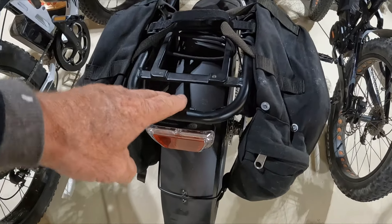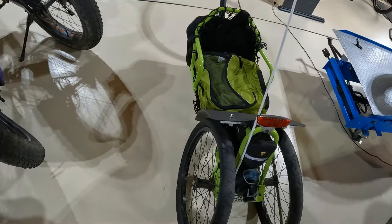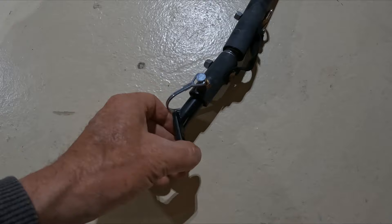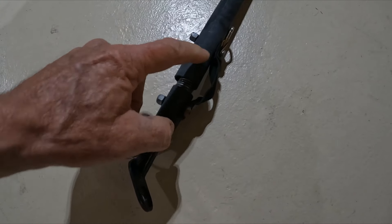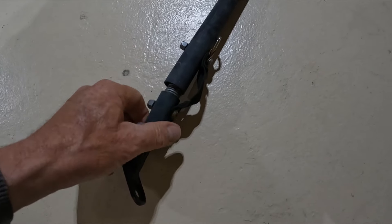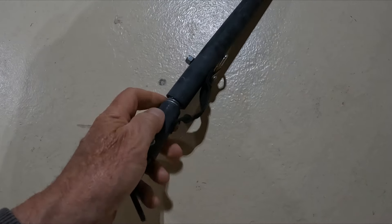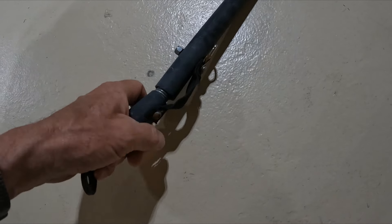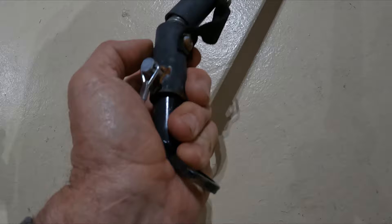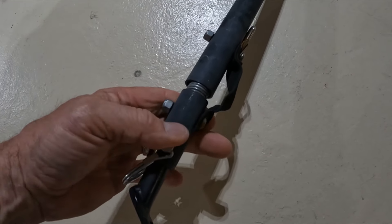You need a really strong rack and you need to not overload whatever trailer you're pulling. This bracket attaches to your rear axle, and there's a spring within it — that's what gives you your flex, and that's your pivot point. I've seen these springs get stretched out and start to expand if you go beyond the limit. So don't take them too far in any direction — up, down, or sideways. But if you're not too hard on them, they'll last quite a while. The spring is just bolted inside the tube on both ends — that's your flex point.